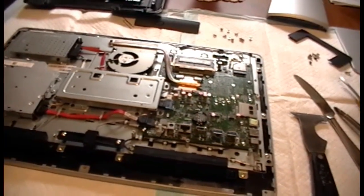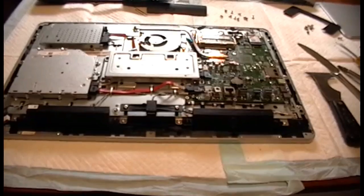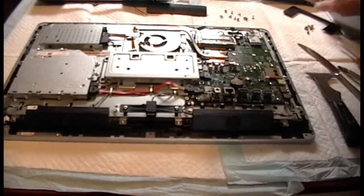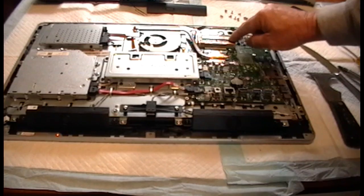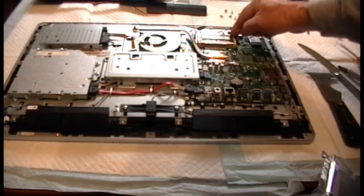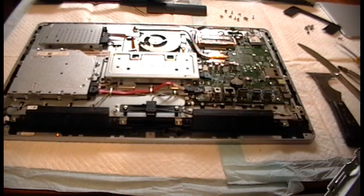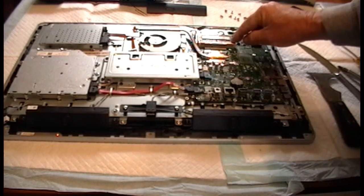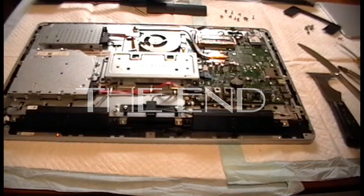Basically, in a nutshell, that's all we need to do. I hope this helps other people, because you're not going to get the right answer from Acer — I'll tell you that right now. This is for the Acer Aspire AZ-700G series. This is a SODIMM, not SDRAM like Acer states. On the website when I chatted with someone there, they didn't know what they were talking about — they were fighting with me. I was pretty sure it was a SODIMM, they kept saying SDRAM. But as we both know now, that's what it is.